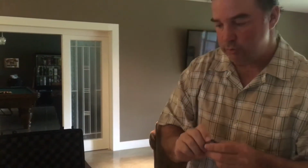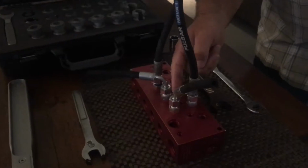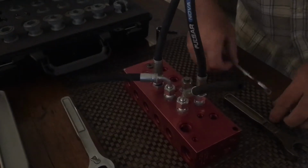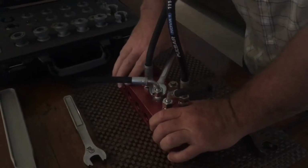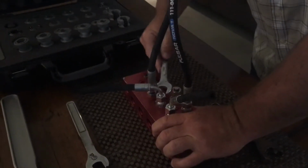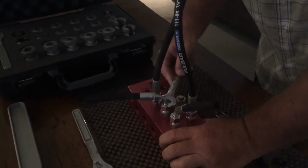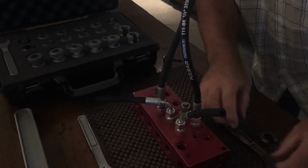This is a line wrench attachment for the RotechTools open-ended ratcheting wrench. A line wrench attachment is distinguishable by the narrow open end. A line wrench is used for brake lines or hydraulic lines such as these, distinguishable by a long neck, much narrower than the fitting itself. Today, people would use this open-ended spanner to work on fittings such as this. Now, as you can see, you can't get this spanner in to re-engage once you've disengaged the fitting. Very difficult to work in tight spaces.